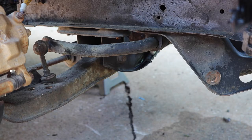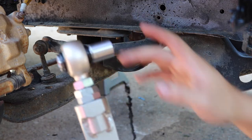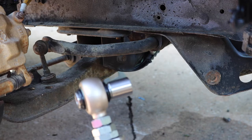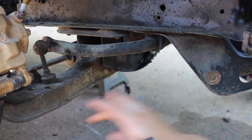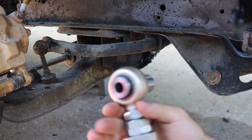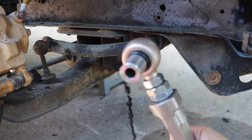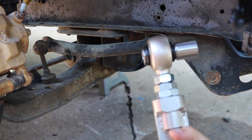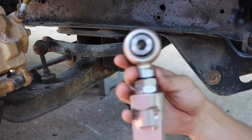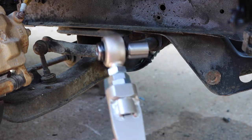Like I said before, this is going to be a super easy install. Normally if you have your stock tension rods or whatever tension rods you have on there, you'd measure them up, compare the lengths, and make sure they're the same distance to save you some alignment time at the shop. But since we don't have any tension rods to mock up against to get a good length, I'm just going to zero them out. This should give us a lot of caster, and they're really adjustable so we're not going to have any problems.